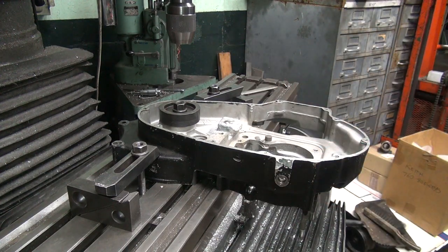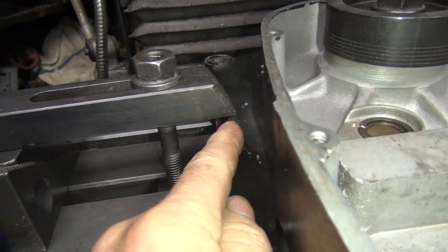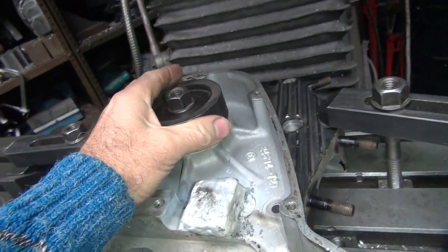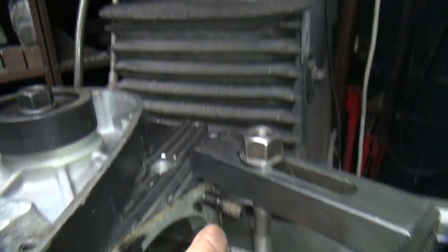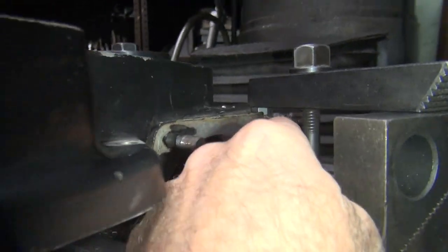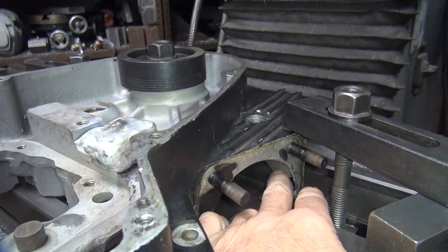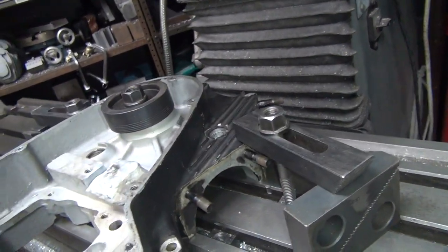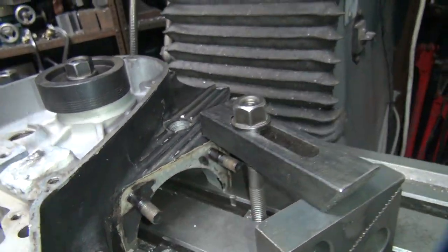Alright, get it pretty tight. So, you got this pushed right here. Like I said, you want to keep where the metal is here so you don't warp it. You got this one to hold the center. You got to keep the torque down on this one because it will indent the case and it can break. And this one here, I stuck a nut under here. You have to see it or not. There it is. That way I can push right here on the center of the case, once again where all the metal is. If you push on the sides here, there's no support, and it will warp the case. And same deal, you can break this stuff. So as long as you keep on the column of strength here, you can actually tighten these pretty good and won't hurt it. You just got to be careful.